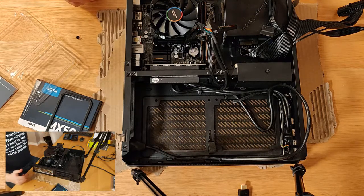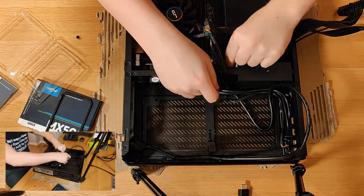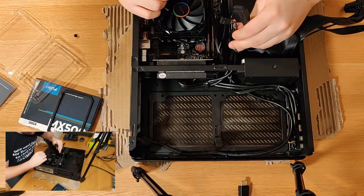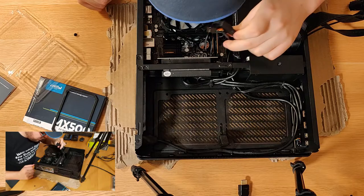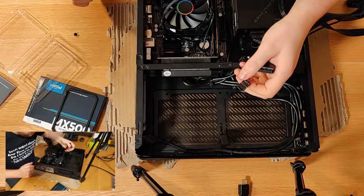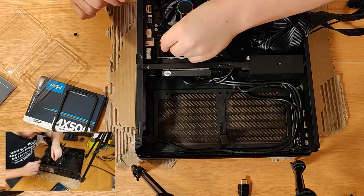So, because there's not that many components to this build, we're actually really getting there. So our CPU is in there, our RAM, our motherboard. Our PCI Express riser is in there, because that's for the graphics card. What we can do now is just try and run these cables through relatively the same way that they were. All right, job done. Okay, so we have a USB 3.0 connector, which has got to go to the far side of the board somehow. Let's pull this round, wish me luck. And on the same connector here, we've just got it kind of cable tied together, but it is actually quite separate. We do have HD audio, which my instinct tells me, and by the shape, is this slot over here.